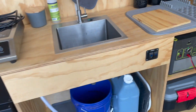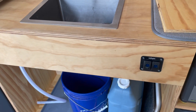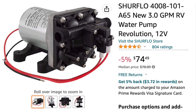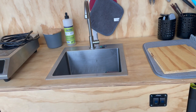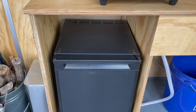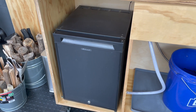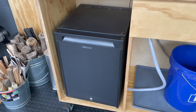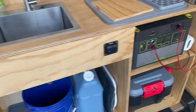The last things are all on this cabinet. There's a circuit in the back with two switches: one runs an auxiliary set of lights underneath the cabinet, which is really nice if I need to get under there and change out a water tank. The other one runs the pump — I turn it on and then the faucet is on-demand. The other part of this circuit runs the trucker fridge, a 12-volt fridge. Set to full, the battery without any solar input would probably last four to five days; with solar input on a cloudy day it'll just keep up with running the fridge.